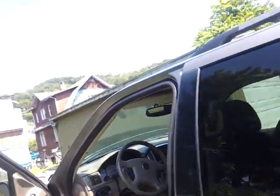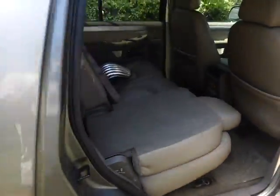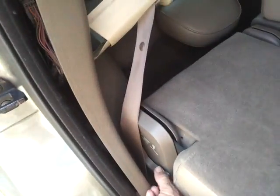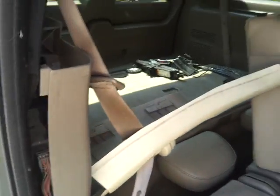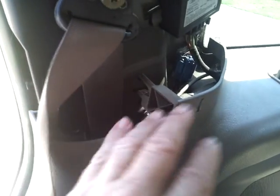Anyway, enough rambling — I'll show you what you gotta do to find your key code. You gotta go around to the back, on the backside behind the passenger side in the back seat. Put your seat down — mine has a little thing here you push down on. I've already pulled this panel off. There's a seat belt there; you grab the edge of this and just pull it off, take your time.